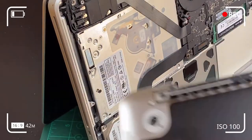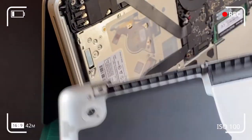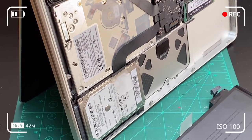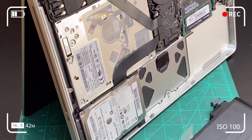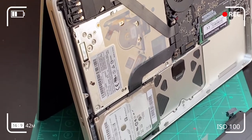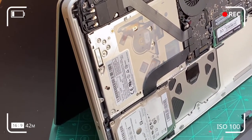There was quite a steady flow of water, which essentially means that the keyboard was permeable — it does allow water to flow through and is not waterproof. I allowed a substantial amount of the water to drain for about 30 minutes, and when I was satisfied that water was no longer dripping from the computer, I proceeded to open it up.